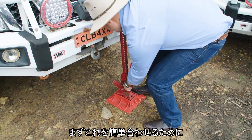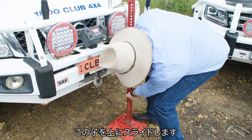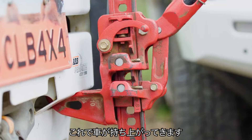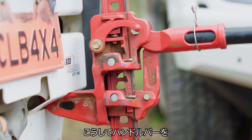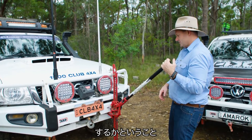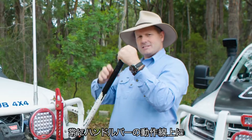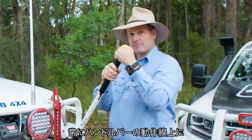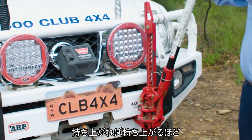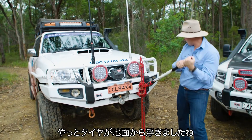To bring this up nice and quickly, we lift that lever up and she crawls all the way up. And what we're looking for is this little jacking spot right there. Now the vehicle will start to come up. Now that I've got that pulling down here, what this thing wants to do is literally flick back up. Always make sure you keep your head out of the way of these handles. And as that car is going up, it is getting heavier and heavier. So now we've got a tire off the ground.